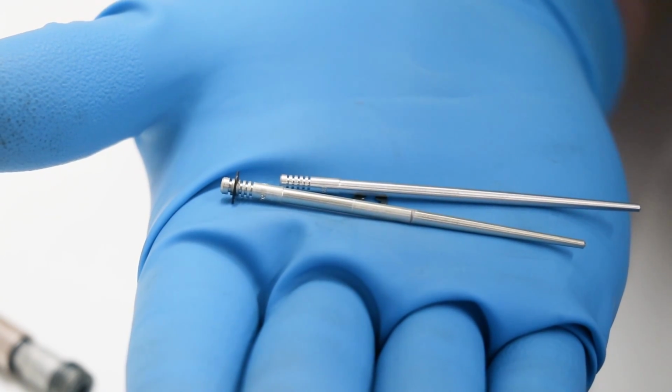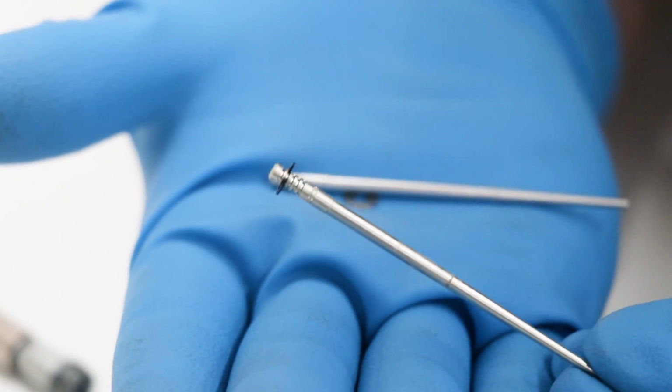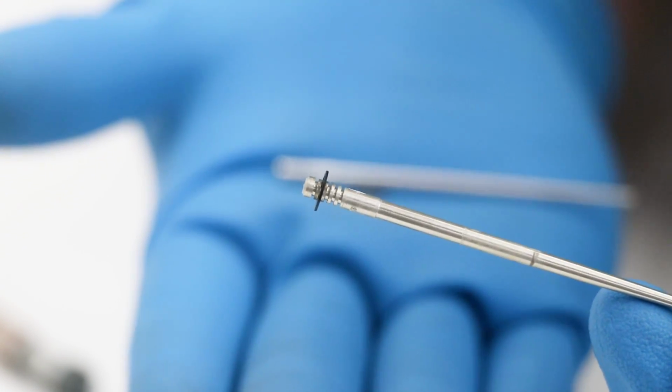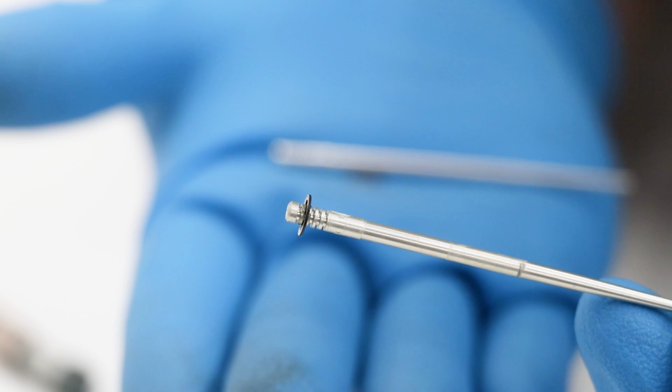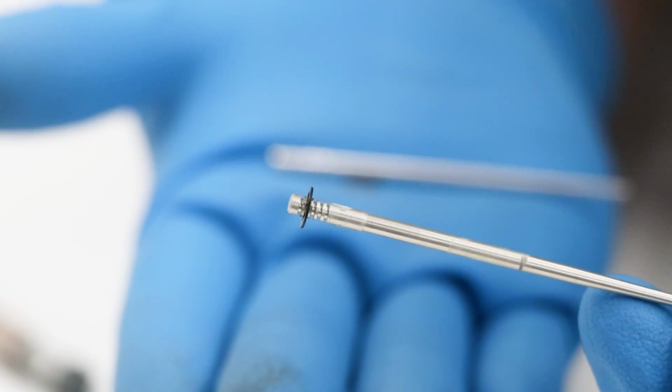So All Balls provided a new needle with this kit, and I'm going to go ahead and set the clip position in the same spot as the original one. So this one is one down from the top. And how this works is if the clip is farther down, that'll richen it up, and farther up will lean out the bike.